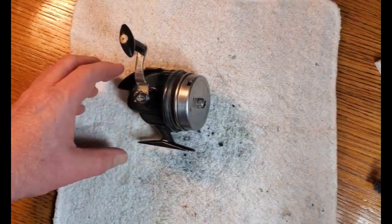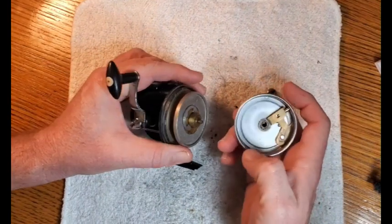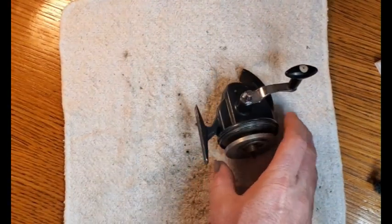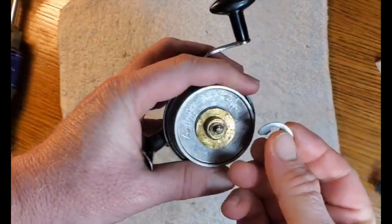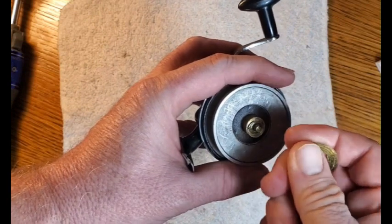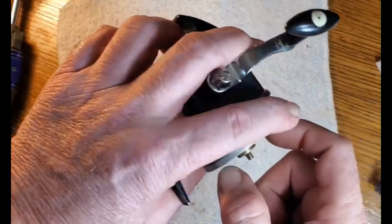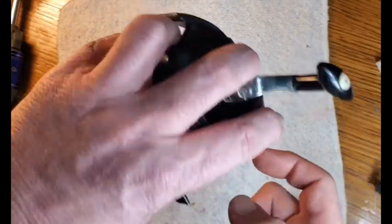Let's get into the servicing. I'm going to start by removing the nut on the spinner head and removing the spinner head — you can see the line pickup mechanism here, it just needs to be cleaned and lubricated. That'll go in the parts bin. To remove the spool, you've got an e-clip here. Then you'll have a brass — or copper, I assume — washer. It's thin and somebody's nicked it up getting the e-clip on and off. Underneath that you'll have a fiber drag washer.